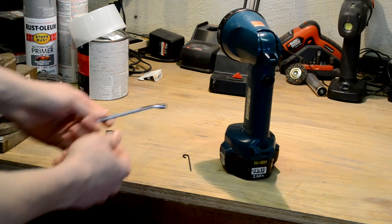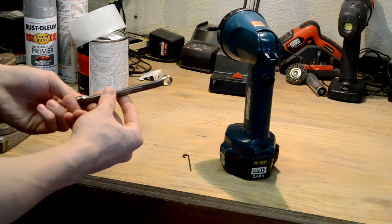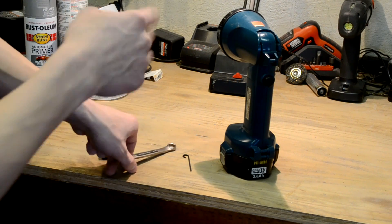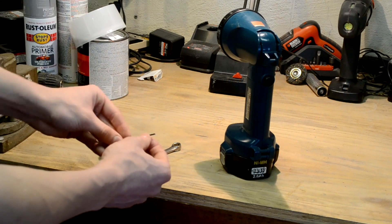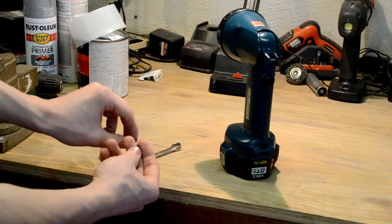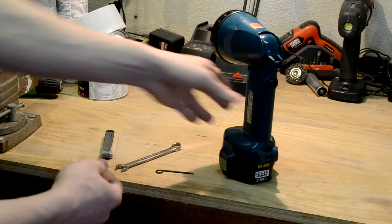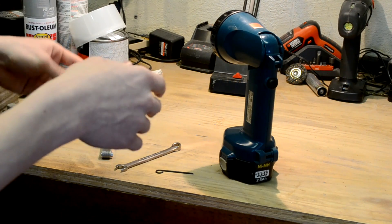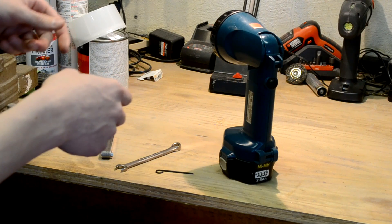You're going to need a 10 millimeter wrench — you shouldn't need a ratchet for that, for the valves themselves. You also want to get a small little allen key — smallest you can find. As well as a flashlight or light source. You're also going to need some ratchets and wrenches to remove the spark plugs, as well as to turn over the crankshaft.